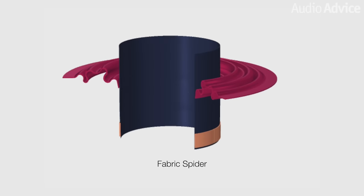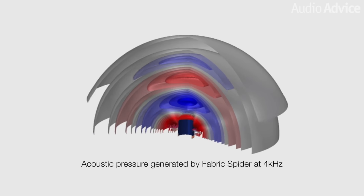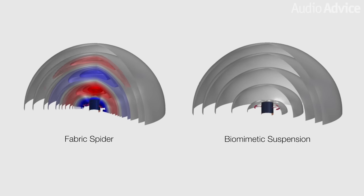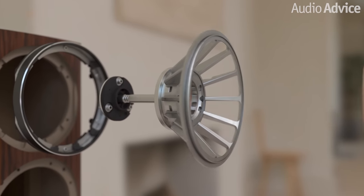In 2007, Bowers & Wilkins made a discovery about mid-range drivers that took them 14 years to design a resolution for. Almost every type of mid-range driver has what is called a spider behind it. This holds the voice coil and is made from a flexible material. It turns out, as this moves, the air generated by the movement hits the back of the mid-range and causes distortion. With the 2021 launch of the new 800 Series, they introduced a way to do the task of the spider but with a material that does not cause this problem, called their biomimetic suspension. The new 700 towers and one center get this breakthrough material. These same models also have a special mid-range isolation system also found in the 800 models — they use a tapered post that goes all the way to the rear of the cabinet where it is isolated with a spring. You would never know this unless you took the entire speaker apart, but it's really cool tech to advance the state of the art.